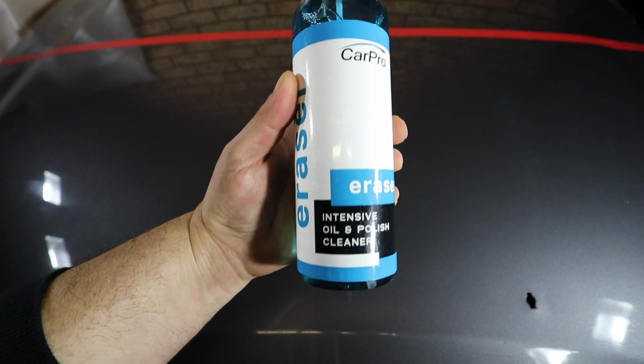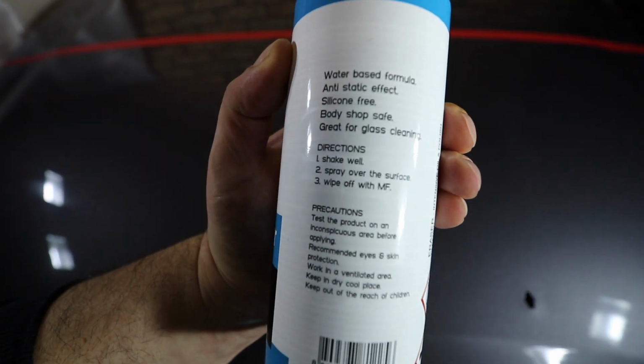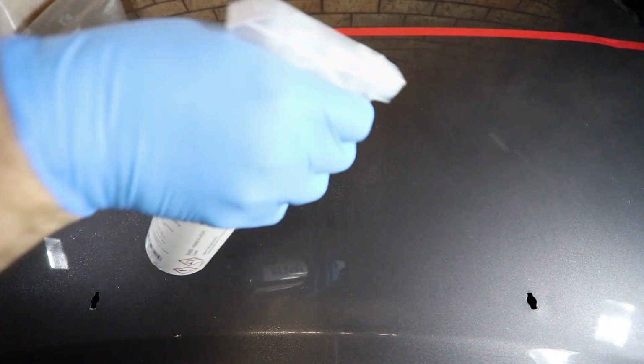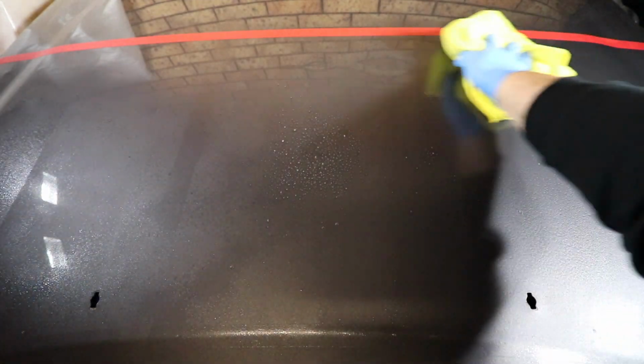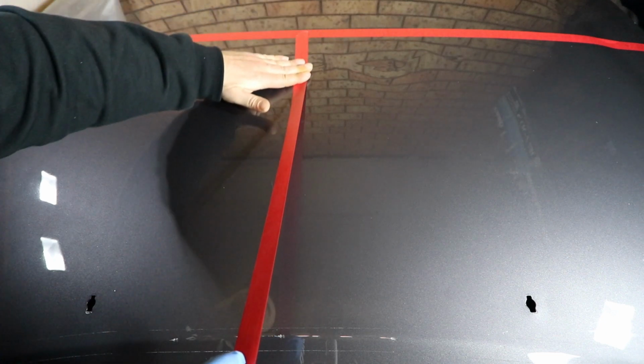And secondly, as my detailing eye became more aware of even minor defects, I could more clearly observe the damage the clay was inducing, and I could clearly see that a clay lubricant with certain added polymers to create more slip, glide and lubrication was being noticeably less harsh, especially on the softer paint types. However, this does create another problem, which brings me back to residue control.